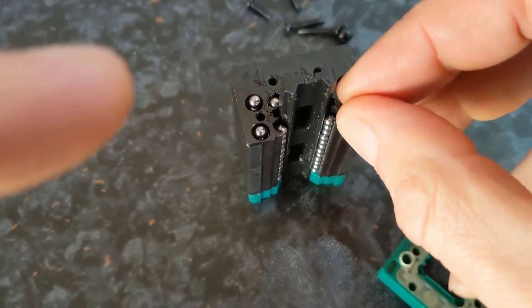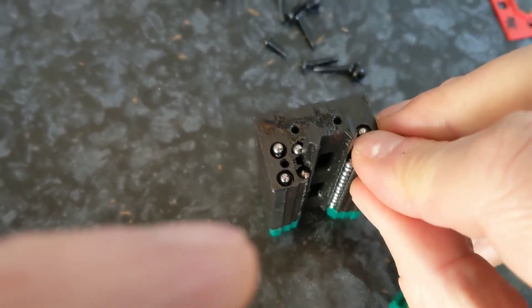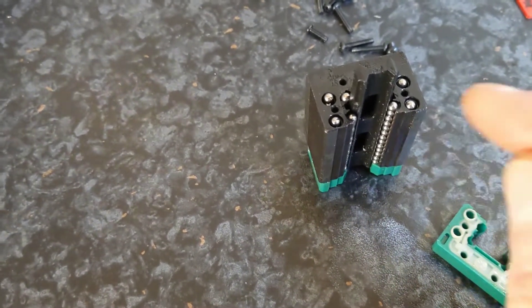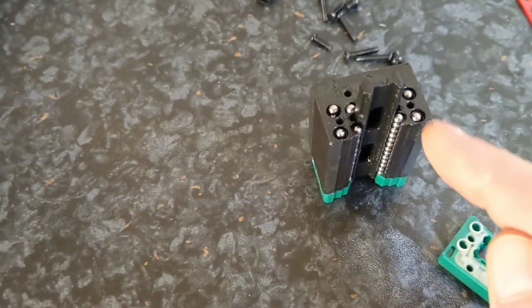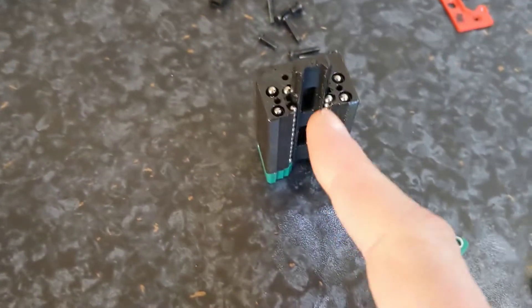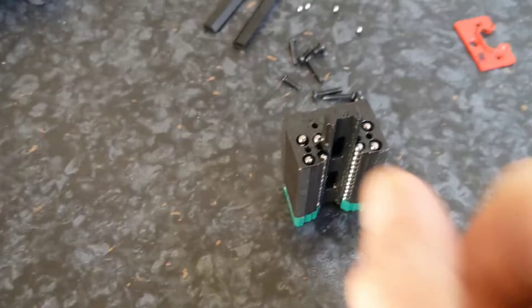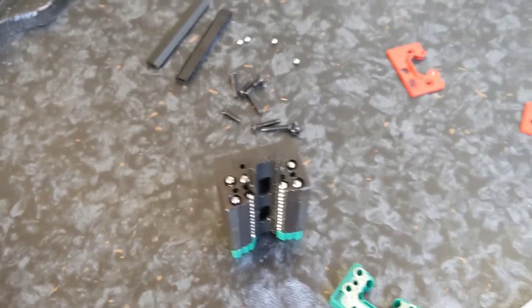If I set a bearing on there and just push it down — if the channel is full and you push another bearing in, you'll see this line push up. So basically, just keep pushing the hole full until the bearings start coming back up. I tried doing it with the plastic retention piece out and just pushing bearings in, but I couldn't get it working. Taking these end caps off is much much easier.